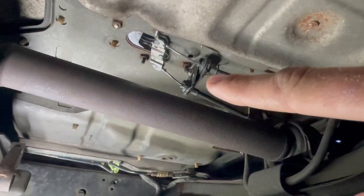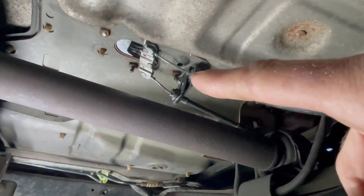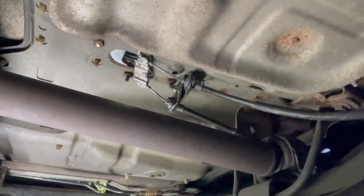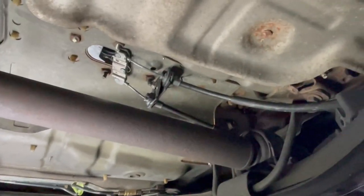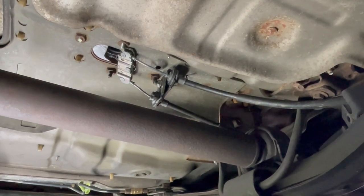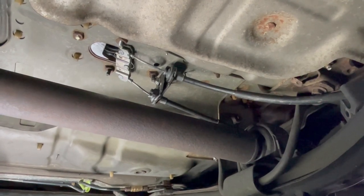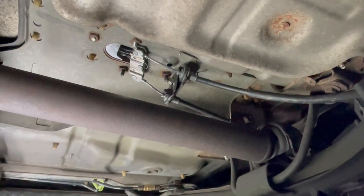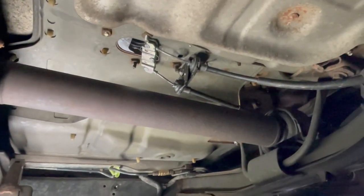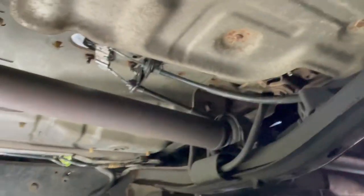That bracket I made, I pretty much just put a bolt in on top of the tunnel and then bent this little piece of steel that I had. It was actually a piece of the old e-brake off the hard body. And I kind of cut it off, heated it up, did some forging and, you know, bent it flat and then bent it at a 90 degree angle, drilled some holes in it, and here we are. Works pretty good. So, yeah. But that's there. Everything works pretty good, man.